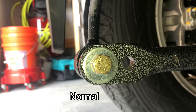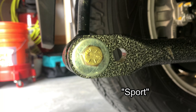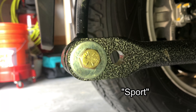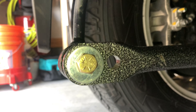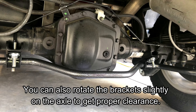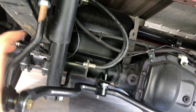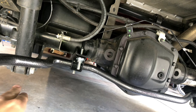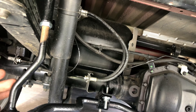There are two holes on the sway bar. The outermost hole is the normal setting, and the hole towards the right is the sport setting. They say to start with the normal setting and see how the vehicle drives, then change to the second setting later if desired. Make any adjustments to the bar left and right before tightening down the U-bolts. Once it's centered, start adjusting the end links — make sure the bar is parallel with the ground. Both end links need to be adjusted to the same length and going perfectly straight up and down, not at an angle.